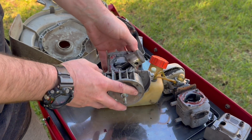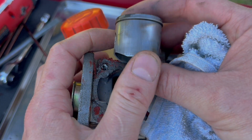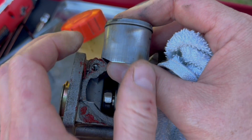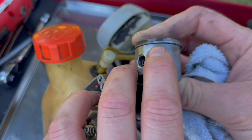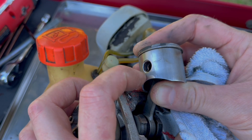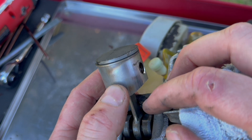Out it comes. So we have — this is the exhaust side skirt — and you can see we've got a small amount of blow-by. Maybe the fuel will clean that up. Small amount of blow-by at the bottom and also a little bit up here. We've got a small amount of carbon formation above the ring and ring land, and also on the side above the ring and ring land. A little bit of blow-by down there, not much else to speak of.